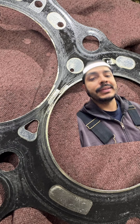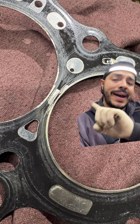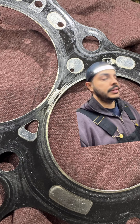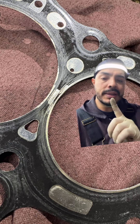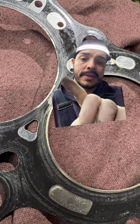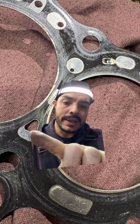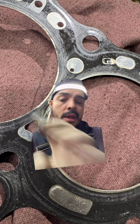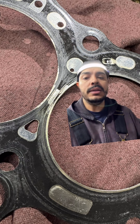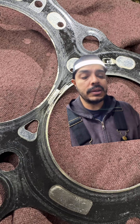Let's talk about the 1.5 head gasket. This is the gasket right here. See how we have this black Teflon material all around the gasket? See how it's missing right here? This is where the leak is. There is a little slit that runs from this hole all the way down to this passage right here — a slit that runs across the cylinder. What happens is coolant passes through there, and over time, with a lot of heat, the coolant starts to push out and disintegrate this gasket, and it starts leaking into the cylinder.